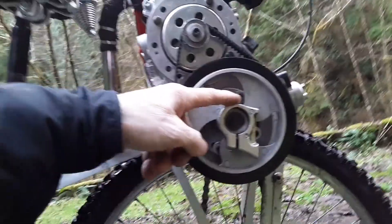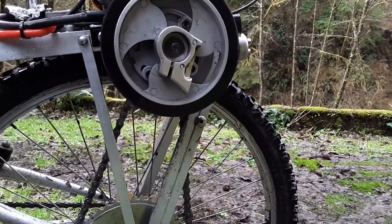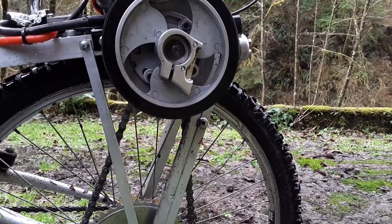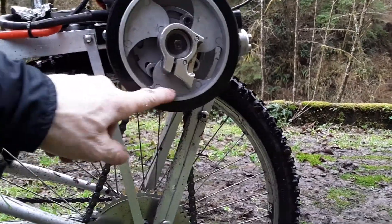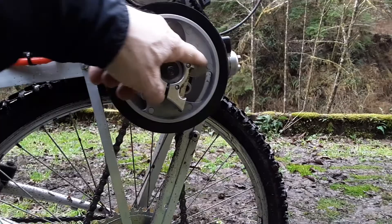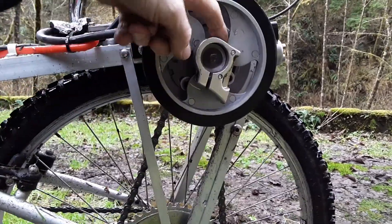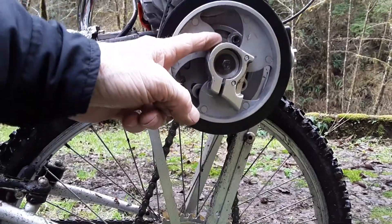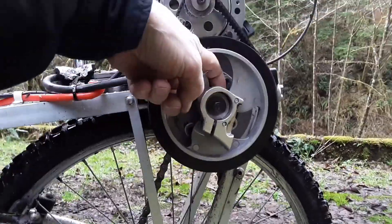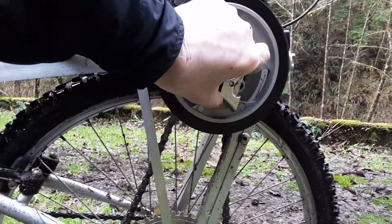That's a piece of a motorcycle front triple clamp — top triple clamp — that I put on there. I cut it off and put it on because I dropped this when I first got it and I broke this hub — it breaks really easy. So I found a way to just temporarily clamp that to the existing hub, flipped it around backwards, spaced it differently, and just tapped, drilled, and bolted those webs to that to get me by.